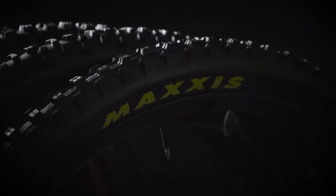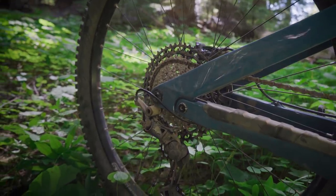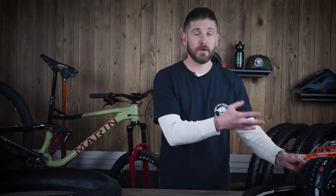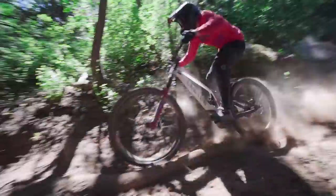When it comes to tires there is an infinite number of possibilities, not just from all the brands available but from the brands themselves. As an example, we've got three Maxxis Minion tires here: a wire bead downhill dual-ply Maxxis Minion DHF, a Max Grip folding bead DHF with EXO protection, and a Double Down Max Grip 2.5 WT Maxxis Minion DHF. Buying a tire can definitely be confusing, and we want to prevent you from buying a tire that might seem like a screaming deal but will end up having you screaming out on the trail.